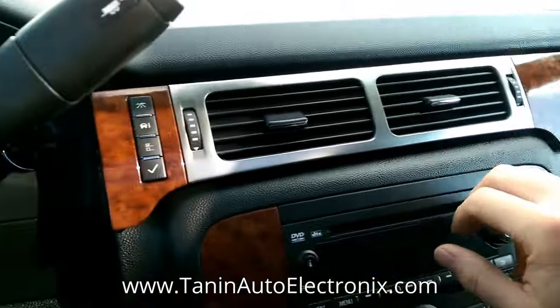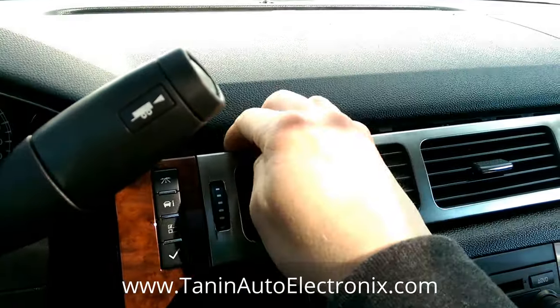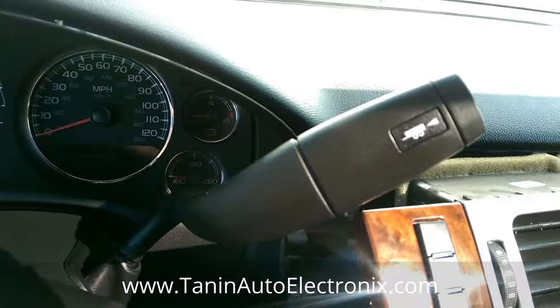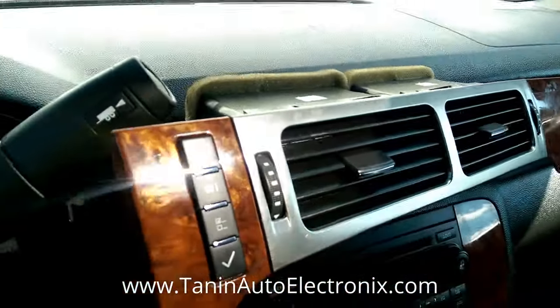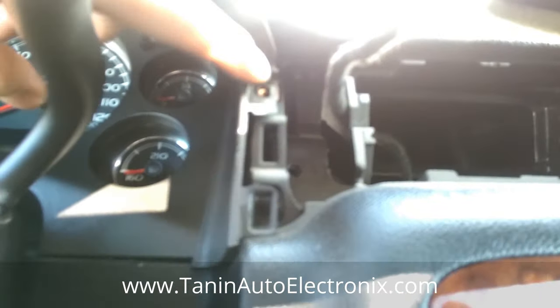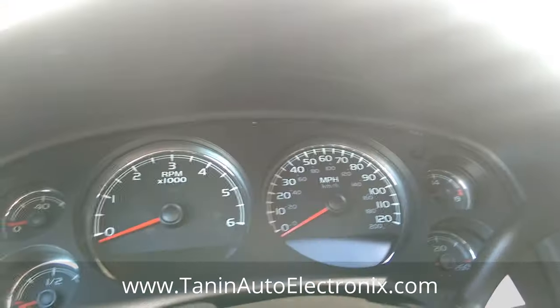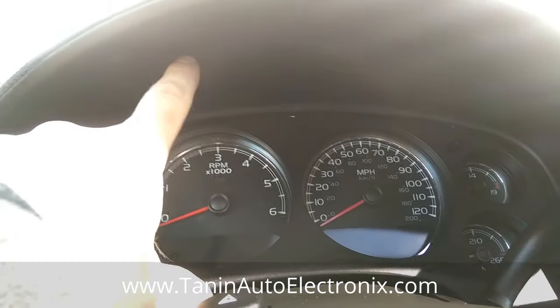This entire panel needs to be popped out. You don't have to pull it out all the way, but you'll have to use a small flat blade tool again and gently pop out each clip. You can get it about that far and then just leave it for now. There's another Phillips head screw here. Once those two screws are out, there's another two up here — one right here and then one over here. You'll have to use a stubby Phillips head screwdriver.